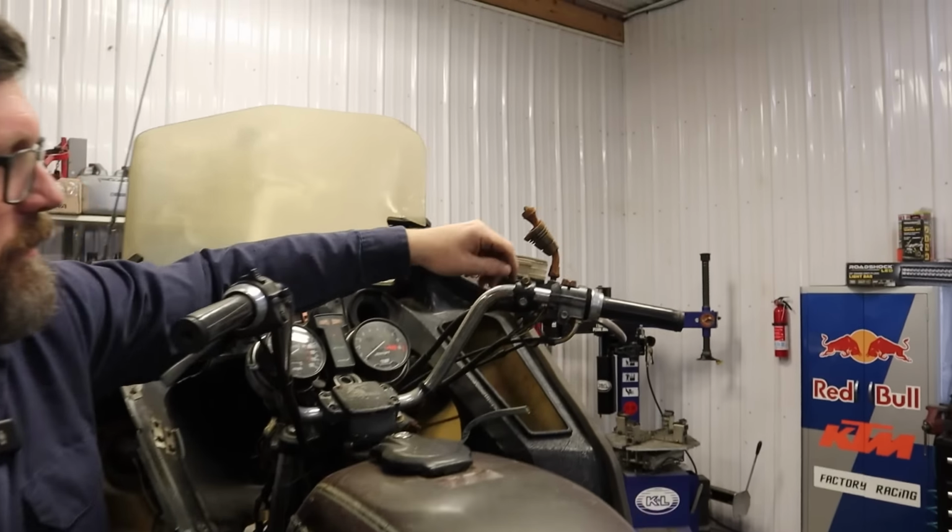Okay, and you claim there was spark over here. You saw the angry pixies? I saw them, all right. I'm going to try to free up these carb butterflies a little bit by just arbitrarily spraying penetrating oil everywhere. Let's work that back and forth a little bit. I might be able to free this up. Okay, it's better than it was.